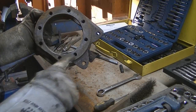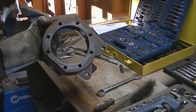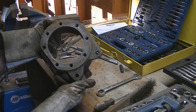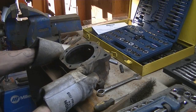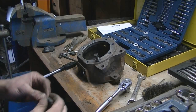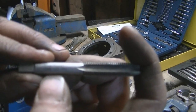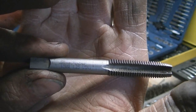I'm in the process of tapping right now. I've got three complete and still have five to do. I'll drill these out to half inch, I believe, and then this knuckle will be ready for my conversion. I just re-tapped all eight holes — they were full of crap. The tap size you want is a 10mm by 1.25, which is what these bolts are.